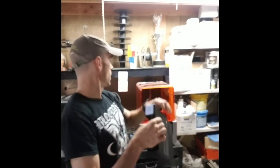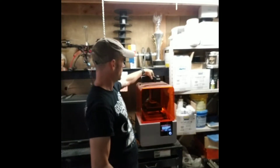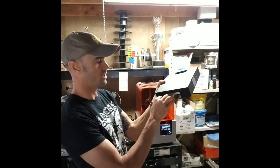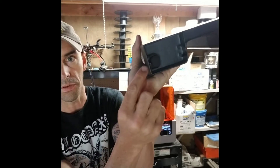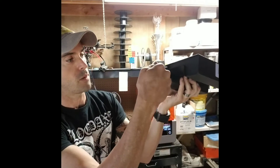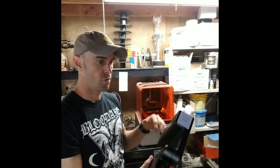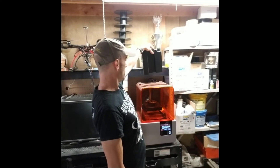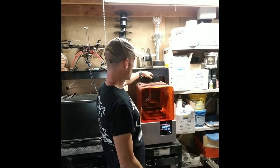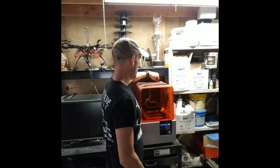All you have to do to swap it is reach behind — there's a little handle on the back — and you just lift out the old one just like that. We're setting this aside for something we'll get into in another video. Make sure your tab is off the new resin; there's the little rubber nipple with a little slit, and there's some kind of mechanism that pushes on it and dispenses the resin, so the resin doesn't actually touch the printer at all — it's all self-contained. Make sure the groove is lined up, then super easy — drop it down in here and push it down all the way.